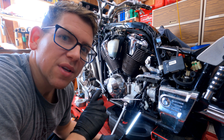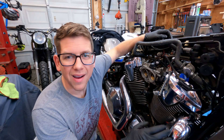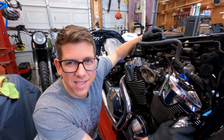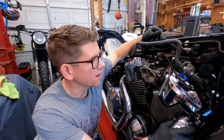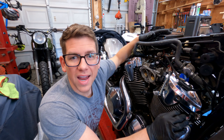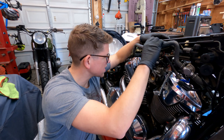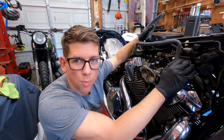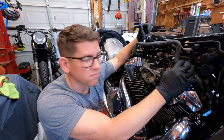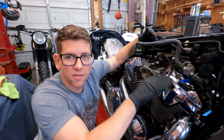It's draining from the water pump right now, so we will go back and get the throttle body. While I'm in here, I'm also going to remove a couple of the weird emissions things that are on this bike — it's called a pair valve. Basically what it does is it recirculates crankcase gases back into the intake. On top of each cylinder there's a reed valve that allows air out and then it's recirculated back. There are all these weird valves and big hoses — it's way over complicated. A lot of people say it runs a heck of a lot better without all that extra crap. So once we remove it, all we'll have to do is fabricate some block-off plates for those reed valves on top of each cylinder jug.